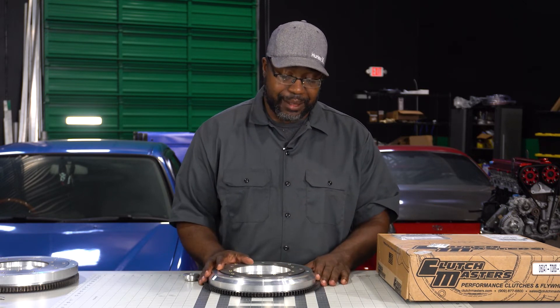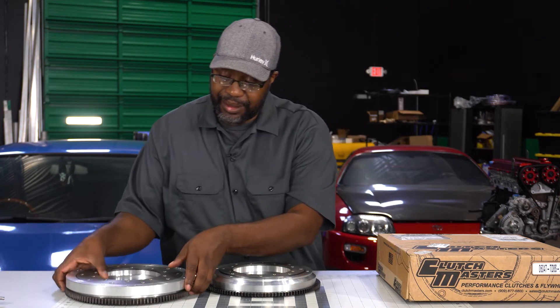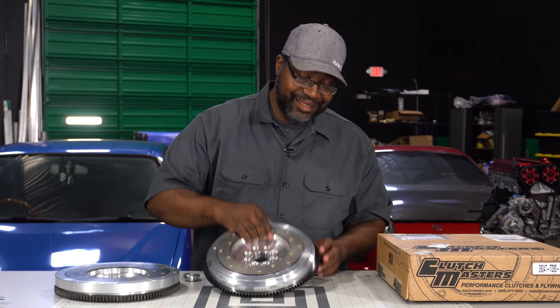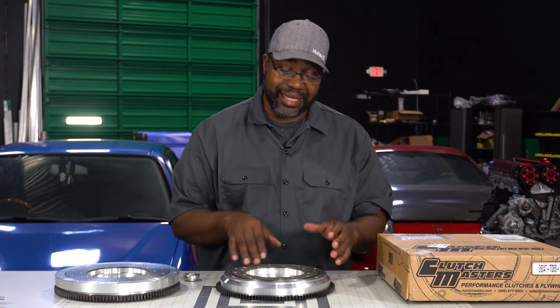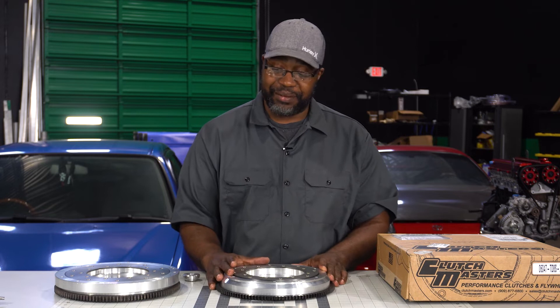You might get the flywheel and notice it's almost flush — realistically about 30 thousandths over the surface — whereas this one is going to be about 100 thousandths, so there is a noticeable step on the twin flywheel. That is by design and by the manufacturer's request. If you get the flywheel, there's no need to contact me thinking it was machined wrong — that's how it's supposed to be. It does have a noticeable step in reference to the outer surface area where the pressure plate feet mate, and I'll go into that a little later because it matches how the clutch was manufactured.